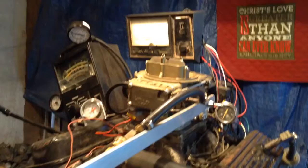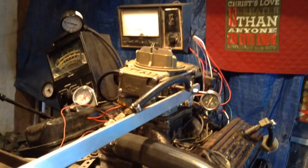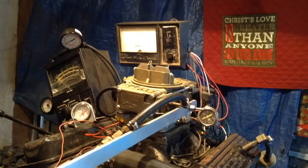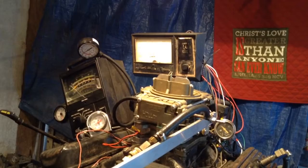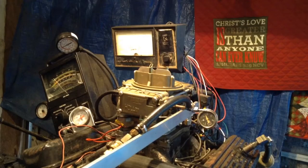We could not duplicate your high-speed fading out or whatever it was doing. We ran it until it was almost in a danger zone. This thing really runs sweet — before it wouldn't even idle, and when you'd go to accelerate it, it would die. Now we're accelerating it just like driving down the road on a Sunday. This linkage here was all bent up, and the ventilation wasn't venting correctly.